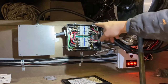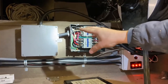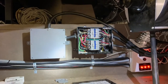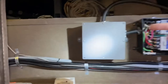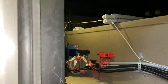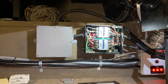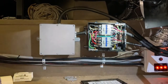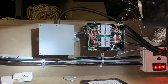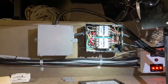The reason we did this as a sub-panel with a little jumper is because we wanted it easy to change out for our smart panel system — the SPS — that we're going to replace it with once that's available. From there, we'll run a wire over to our inverter on the other side, and the inverter will feed that smart panel as well. We'll be able to pull from any of those power sources, and it blends the power to produce your desired output. For example, if your desired power is 50 amps, it can blend 20 amps from a plug-in at somebody's garage with your inverter battery bank capacity, and if needed, blend in generator power as well.